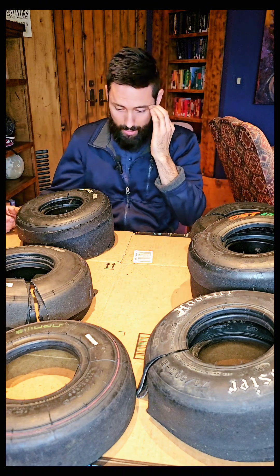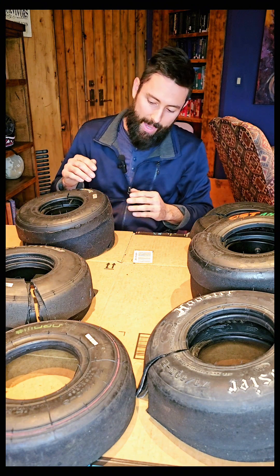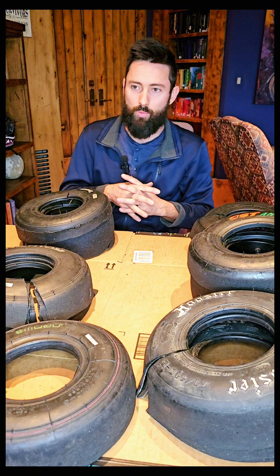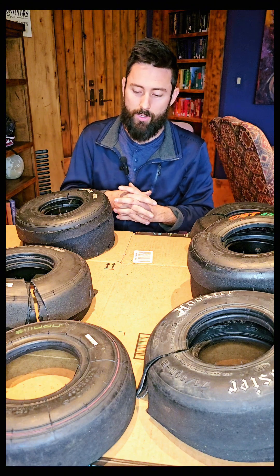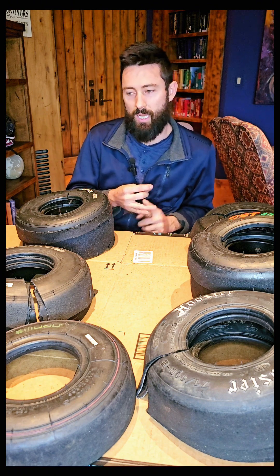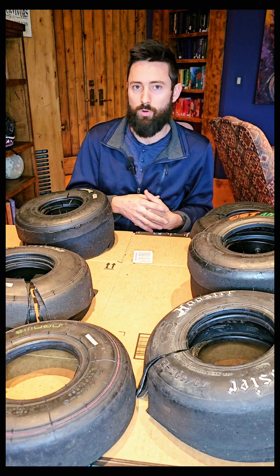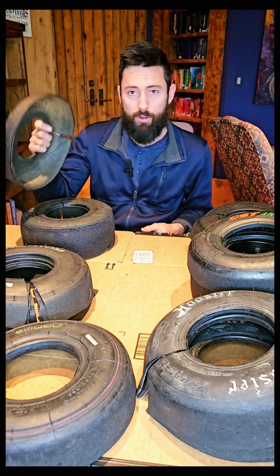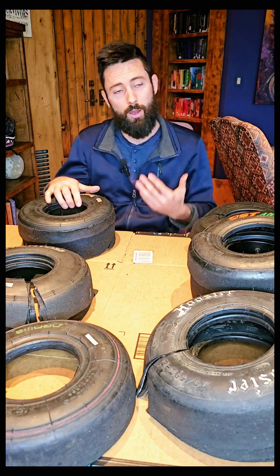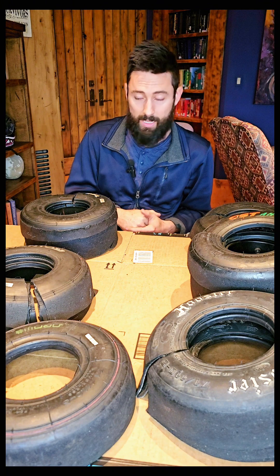Let's dive into the MG. The MG is a very unique tire in the rubber that it uses. It uses some type of rubber that is not a traditional rubber. The way it heat cycles is very unusual — it's rock hard when it's at room temperature or cold. We found that on cold tracks like in Las Vegas, temporary tracks, anywhere up North where it's cooler, or karts that just don't put heat in the tires — carts that have 10 to 15 horsepower, so juniors and cadets — it's hard to get heat into this tire, and so it feels mega slick. It just doesn't fire off. At our track with a shifter, we don't have that problem.